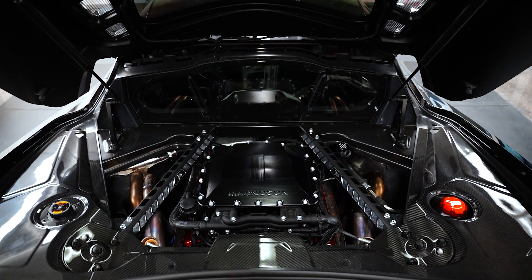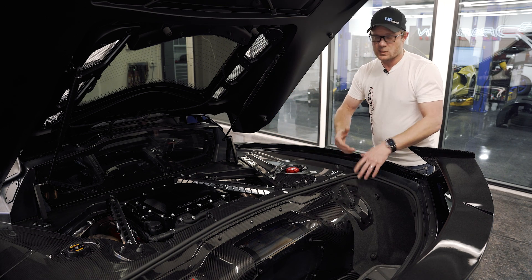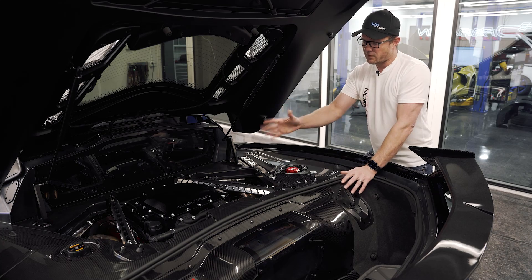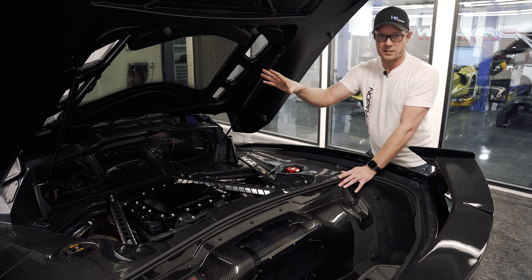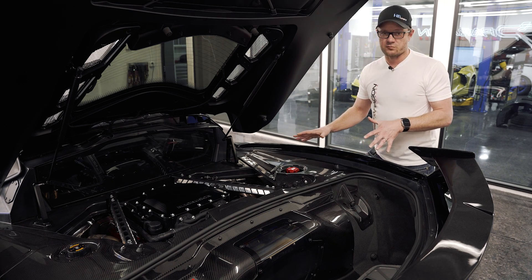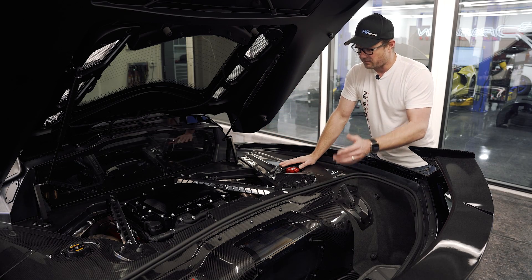The Lingenfelter kit uses a Magnuson Supercharger, and this is a really nice OEM feel, fit, and finish to everything on here. We're very impressed with how it all looks, how it all comes together, how it fits, and how it drives. This system is very much like a C7-Z06 supercharger in that it's a positive displacement style on top of the engine, which offers really nice drivability. It gives you boost very quickly in the RPM, so you get a lot of extra mid-range torque, which we'll show you in the dyno graph. Still really solid top-end power as well — this basically drives like a C7-Z06 power band in a C8, which is really fun. This car also has some header upgrades and an air intake for a little extra bump in power, but other than that, it's a very solid kit all the way around.